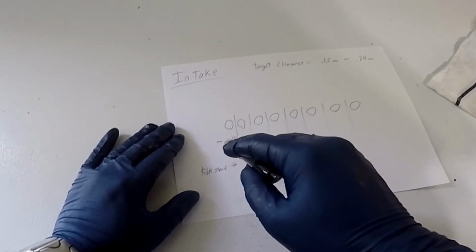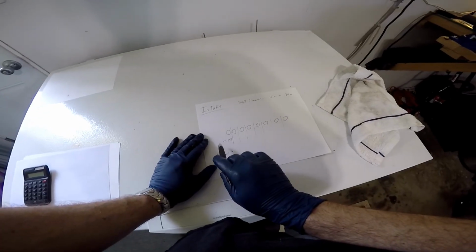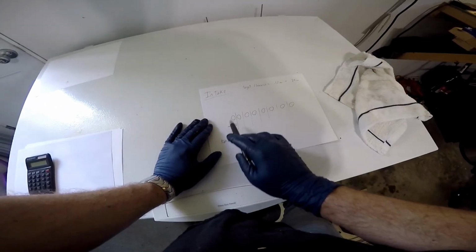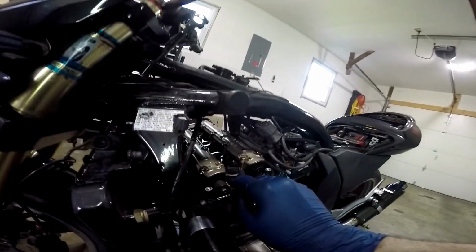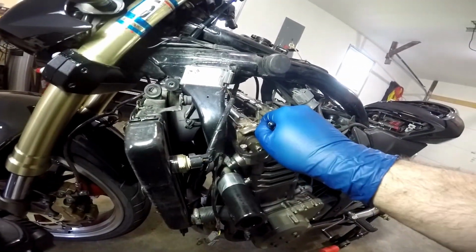We're just going to repeat that process for every other valve. We're going to measure, and we're trying to find what the clearances currently are. So we're just going to keep going down the line just like you saw me do, going down through and checking each one. Now, there are 2 valves a cylinder, so the next cam lobe is in the same position as the one I just did because they're in groups of 2. So I can go ahead and check that one as well.